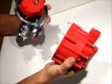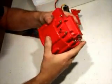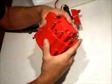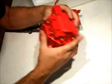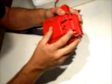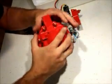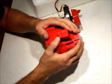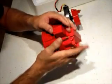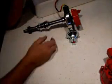What we got here is a regular General Motors cap. I can go buy a cap for an eight-cylinder Chevy with HEI and replace this cap with that. They give you a brass terminal cap. The coil is right on the top — it's a one-wire hookup. You just hook a hot wire to it and you're ready. The other terminal is for a tachometer, so that's simple too. You don't have to mount other boxes or anything.